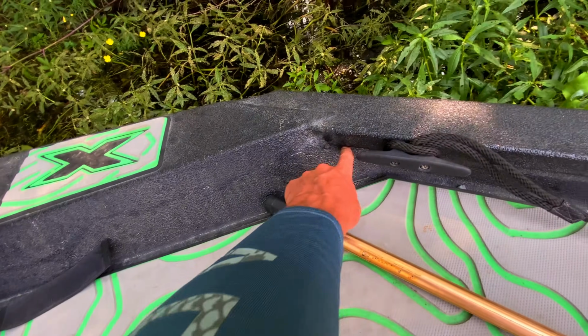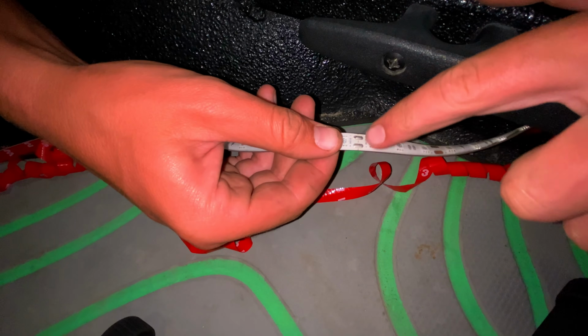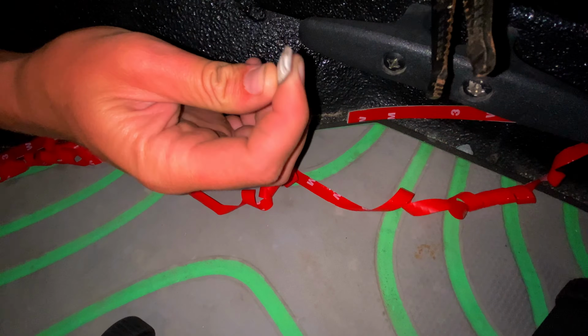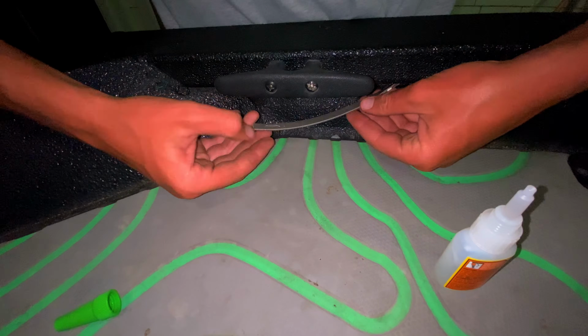And when I got to the end, there's a few extra feet of wiring, and you can actually cut the LED strips, and they have these little cut marks on it where you can cut it and actually trim it to size. And so I went with the 32-foot LED strips. It's actually 16 feet in 2 strips. They just call it 32 feet. And so now I have two, probably 2.5 foot strips left over that they also come with wires at the end of it. So I can actually use those extra wires for something else.